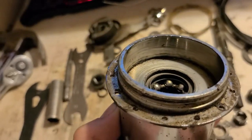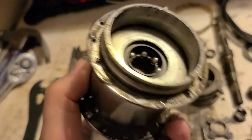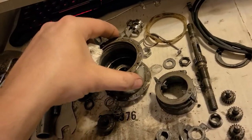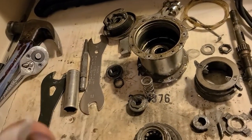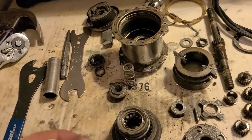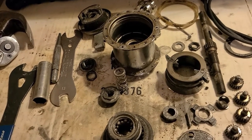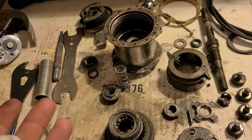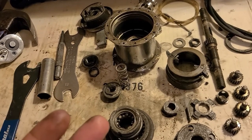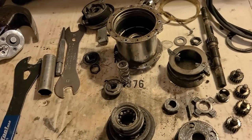The thing about a brake drum is that you don't want grease in there or oil. Maybe that's why it was greased in the first place — I don't know. But usually everyone says grease is not good for any brake, including myself. I think grease does make the hub feel very slow — it already feels slow compared to a normal single speed. But with grease in there it's like a workout all of a sudden. In low gear it feels fine, but in high gear it's really excessively forcing yourself to pedal.